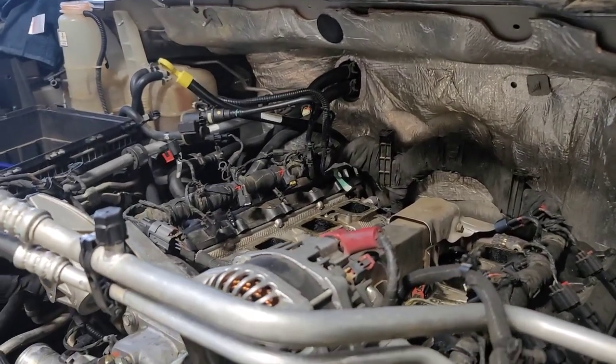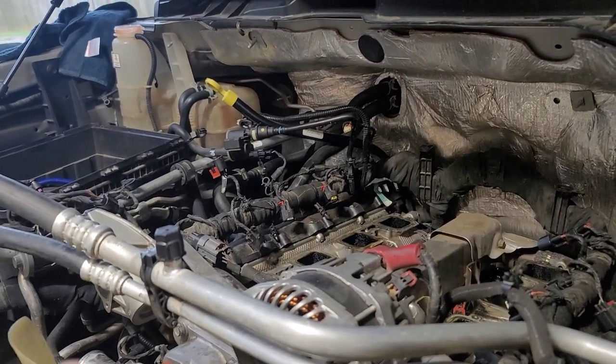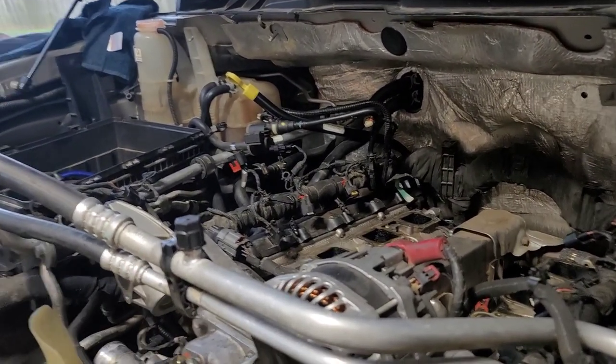What we're having to do here is replace the camshaft, lifters, push rods, everything, head bolts, because this has to do with the infamous Hemi tick. Now, y'all may be freaking out and thinking, well, mine's ticking. Well, you'll have to do your homework on it, because there are other videos. I'll try to find them and post them in the description. But if you do not have the problem that my father's having, you do not need to replace your camshaft. It could be other problems.